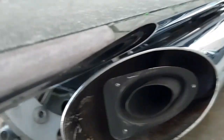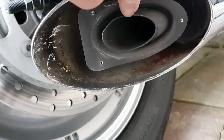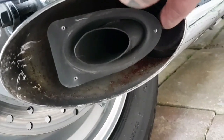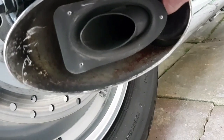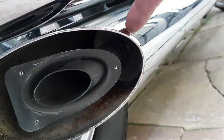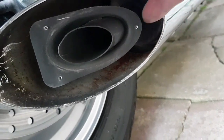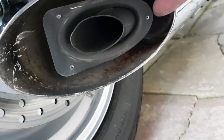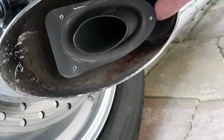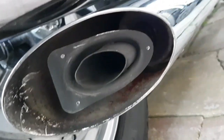You'll be left with that — the carrier. Now this pipe has to be cut back as tight in there as you can. You've got to protect the edge of this chrome with tape or rubber, anything so you don't mark it. I'm using just a hacksaw blade with a rag wrapped around it to cut that pipe. Bend this tab back out of your way.